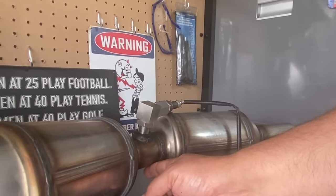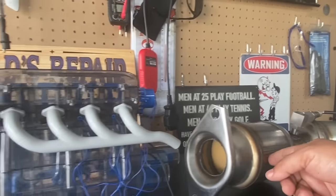You want to investigate from the downstream oxygen sensor all the way back to the engine block. Putting in one of these catalytic converters can be very simple or very complicated — it really depends on the vehicle. But the vehicles that often have their catalytic converters stolen are the ones that are very easy to swap out, so if it's easy to steal, it's probably easy to install and you'll be able to find it on the open market.